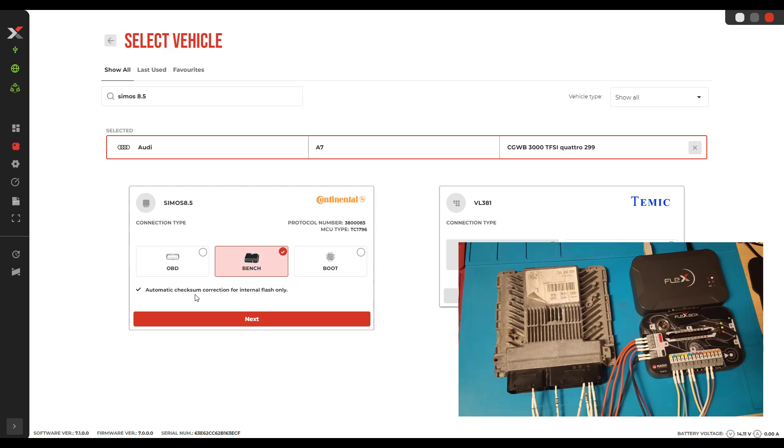You will move the data — the flash and the EEPROM — from here, and after that you must program the ECU using VAG CAN PRO or ODIS and program the FRF data. That is another story and will be another video. I will take my time and show you the clone procedure for this type of ECU. Until that video comes, thank you for watching and see you in the next video. Bye bye.